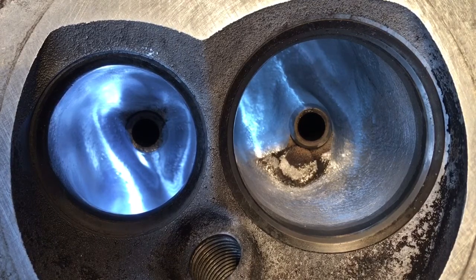If I can get 375 to 400 horsepower naturally aspirated out of it, or if I could get lucky and get 300 plus to the tires NA, I'll be more than where I want to be once I put the boost to it. Like I've said in all my previous videos when I mentioned boost – you can take a naturally aspirated cylinder head that flows, say, 250 CFM on the intake side, put boost to it, and that all skyrockets. That head flow doesn't become a deterrent until you're up into some astronomical amount of horsepower, because you see people all the time making darn near 1,200 horsepower to the tire through what they're claiming to be unported 243 cylinder heads.